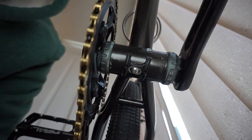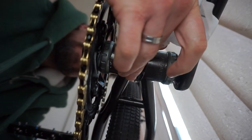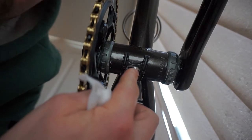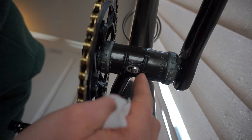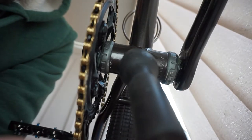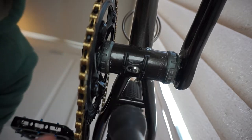This glue does expand, so I'm just wiping off the excess and checking for any on the back. I'm only going to be using one side of the cable guide for the cable that runs along the chainstay to the rear derailleur, so positioning isn't too crucial. I could even cut that arm off if I wanted. I've got a screwdriver with a bolt in the end to get it to the right height — wedging it against the ground.